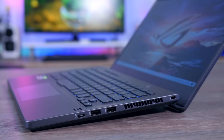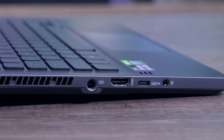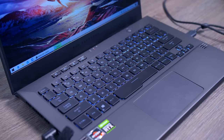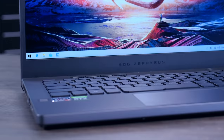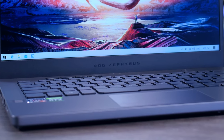In terms of connectivity, you get two USB 3 ports on the right along with a USB 3.2 Gen 2 Type-C port. On the left there's a power connection, HDMI port, a combined audio jack, and a USB 3.2 Gen 2 Type-C port that also supports DisplayPort 1.4. I think they should have added another Type-A port so gamers can plug their mouse into the left side. By default you get a 180W power adapter, but the USB-C port on the left also works with a 65W Type-C charger, so you can bring a compact charger to school or the office and leave the bigger one at home.